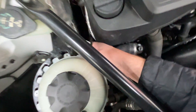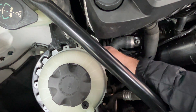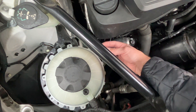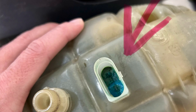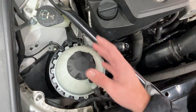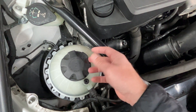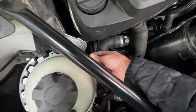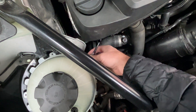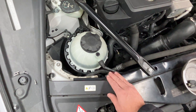There's another type of coolant expansion tank — it looks just like this but the terminals are different. Those have an issue where the electrical pins get water seeping in from the tank, which oxidizes and corrodes the pins, and then you'll get a false warning. In that case you also have to replace the complete tank, as the float and electronics are actually built into the tank. Most of these tanks do come with a new sensor anyway, which is nice, so you don't have to worry about swapping those out, but it's pretty common on this model.